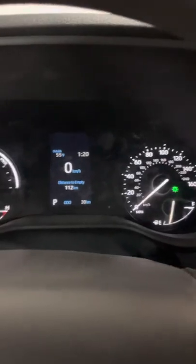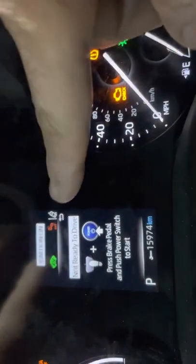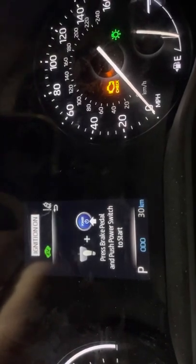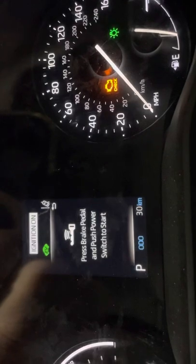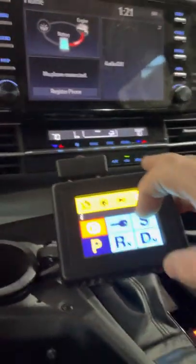I didn't show the lane assist, so I'm going to show it again. If I manually turn on the lane assist, as we can see here, I'll shut down the engine from the screen. I activate the ignition first — accessories on first press, ignition on second press. The lane assist is still on and will be automatically cancelled only after starting the engine. Now I press and hold the touch screen — we have the ready signal showing the engine is running — and the lane assist will automatically cancel five seconds after the engine is detected.